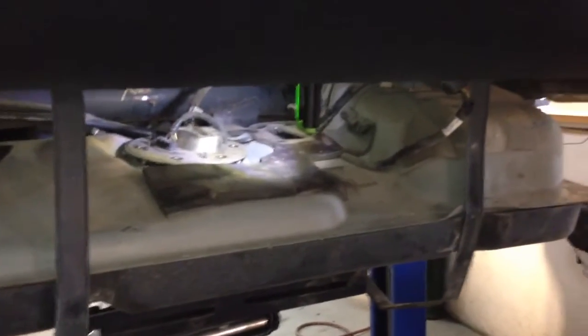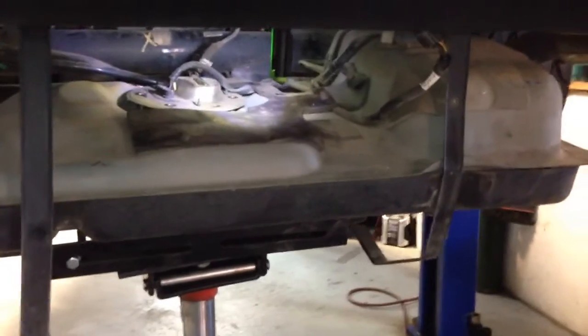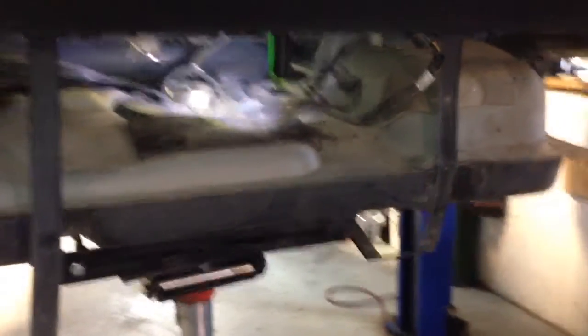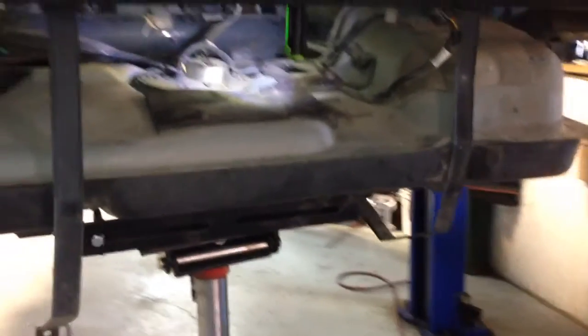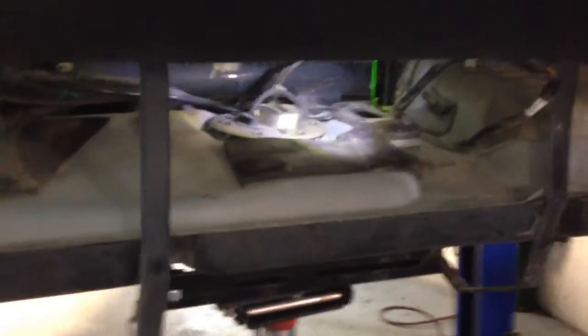Thanks for watching. You need to test your circuits — test before you replace stuff. In this case, we tested all the circuits: duty cycles from FPDM to PCM, PCM to FPDM, voltages at the pump. The computer was grounding the opposite side of the pump, doing what it's supposed to. Everything checked out, so the only other thing it could have been was a mechanical issue — and there's the mechanical issue. Nine times out of ten it's a mechanical issue, not your tune, not the circuit. Especially in a clean, low-mileage 2003-2004 Cobra, you're not going to see circuit issues.